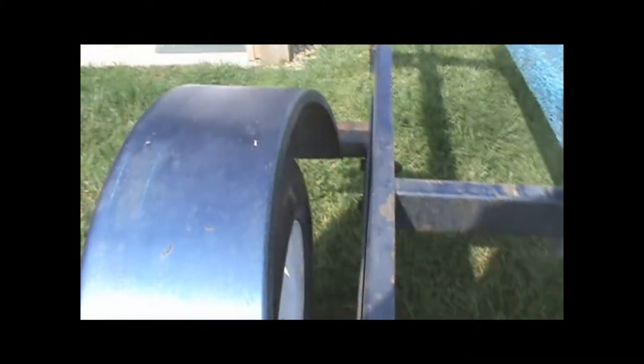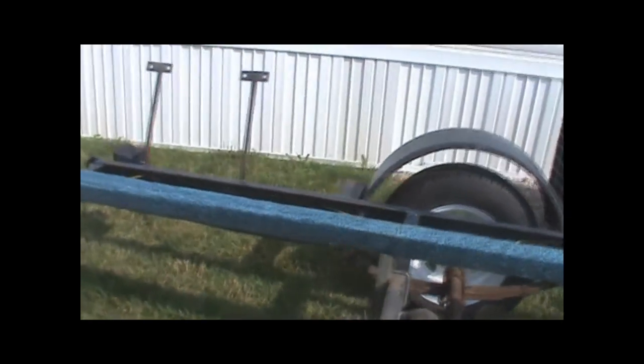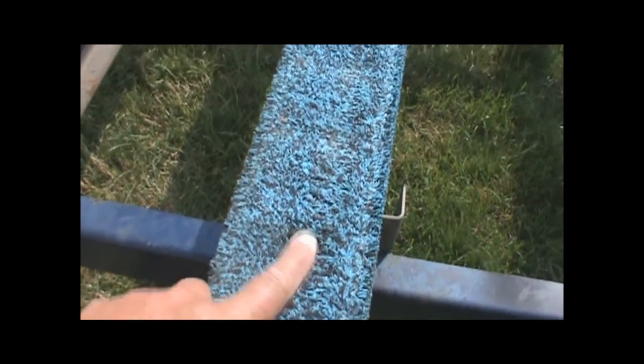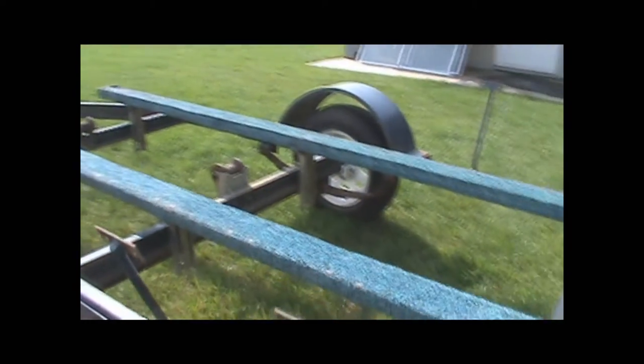See how rusted the axle is here. Going to make all new wood plates in here. Got some steps made. Probably put two new lights on — those aren't working the best. People can see here in the bunk boards, it's not a good thing. Boat was coming on and off right here. Got a bolt right here that was rubbing the bottom of the boat. Carpet wouldn't do much good, so I'll recess those. These uprights here had to be straightened, got those straightened.